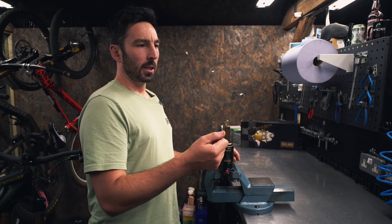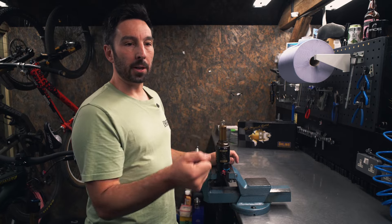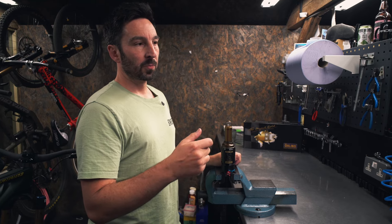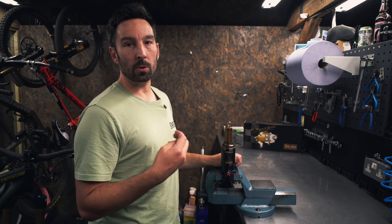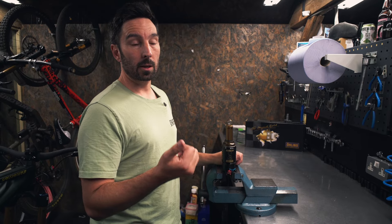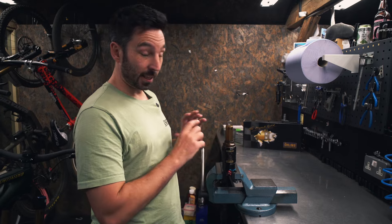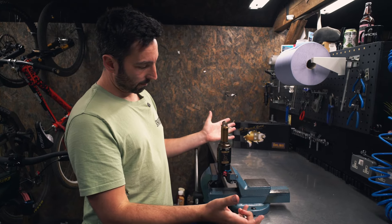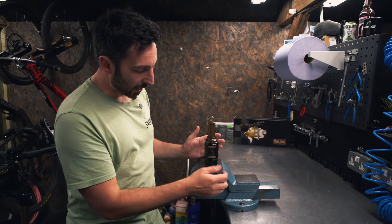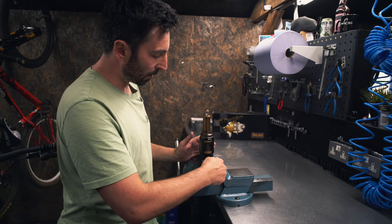It's quite tricky to take a shock off one bike and put it on another, because the whole air spring architecture, volume, the damper tune, and the way the shims work are specific for the leverage of that frame. Rear shocks are a hell of a lot more complicated than forks, purely because forks are a one-to-one ratio and don't have leverage applied. But that is basically exactly why Specialized have done this. Let's get the air out of it and pop the air can off.